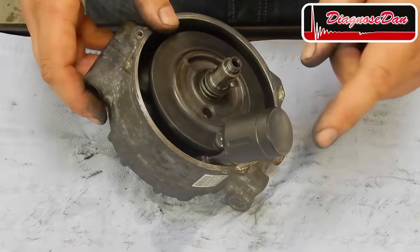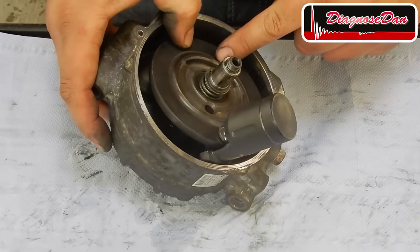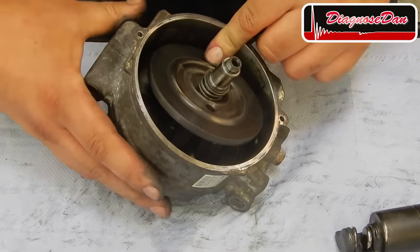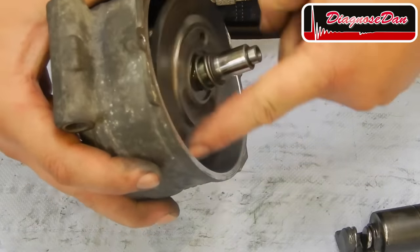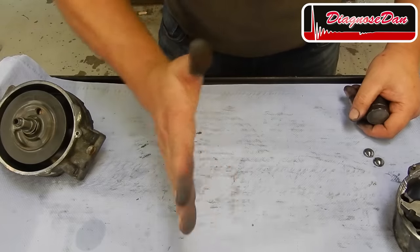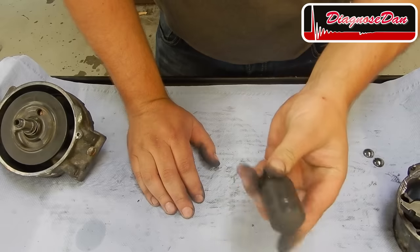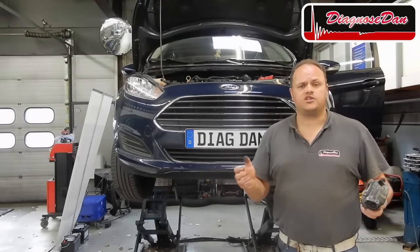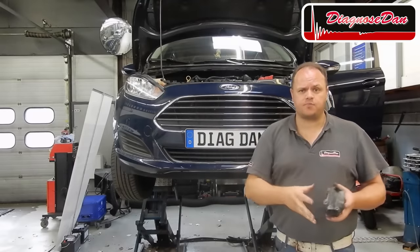Now, in order to get a back and forward motion of our pistons, we can set the swash plate at an angle. Now, as we turn the swash plate at an angle, we can see we get this asymmetric motion. The motion of the swash plate results in the back and forward motion of our pistons. We've learned we can adjust the stroke of the pistons by adjusting the angle of the swash plate.